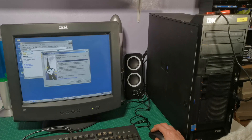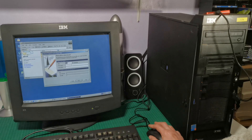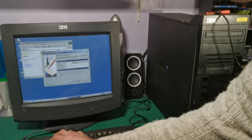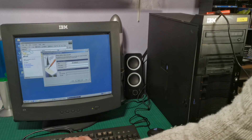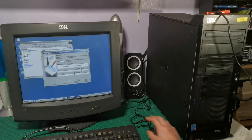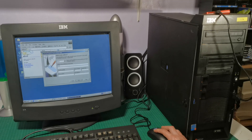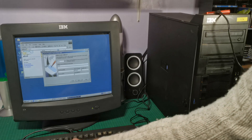The last thing I'm going to do is install Norton Ghost on here because one of the primary purposes of this machine is going to be to dish out images to my other boxes so I don't have to spend the rest of my life installing Windows 98 and DOS. We'll have a little network switch where this thing will sit under the desk and I can just plug the other machines in and pull stuff and push stuff across. I'll also create little packs of drivers for each machine and every graphics card that I've got, all different versions, so I can try out different versions with cards and things as they come in.